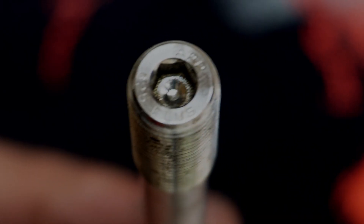Now that I've got the heads back and the mating surface all cleaned up, before I put the head gaskets on I need to put in these ARP head studs. These are the ARP Custom Age 625 Plus - they are much higher tensile than the standard head bolts, and even further of an upgrade to the ARP 2000s. It's going to be a little overkill for this engine, but being that it's my wife's daily I just want to make sure it's not going to blow a head gasket again. When you get the kit you'll have ARP fastener assembly lube, and this stuff has to be used to get the proper torque that ARP specify - otherwise you're not going to get the clamping force you need.